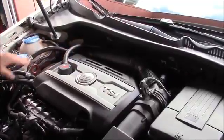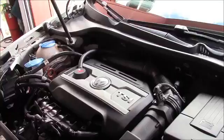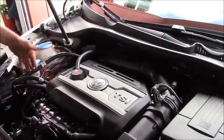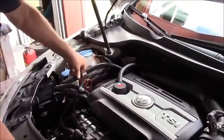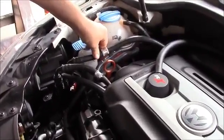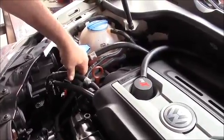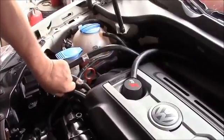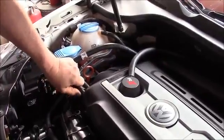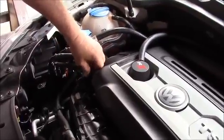This is separating and trapping oil from entering the intake air tube. We've got our evacuation in-boost outlet here, secondary outlet. This one right here for primary and non-boost. And our crankcase vapors. As you can feel, this is nice and hot, showing it's been working properly.